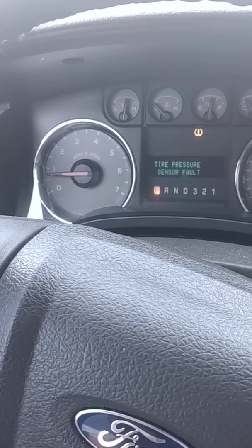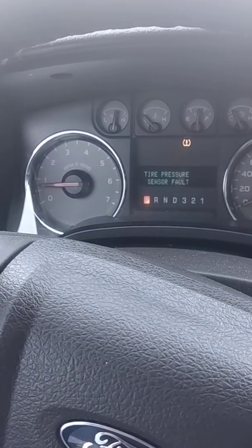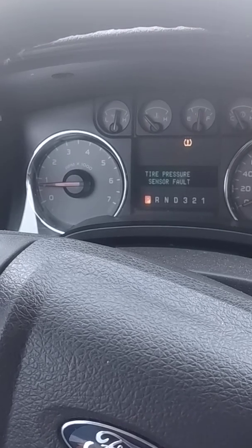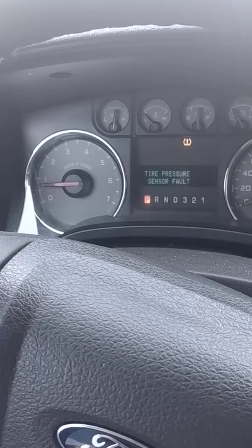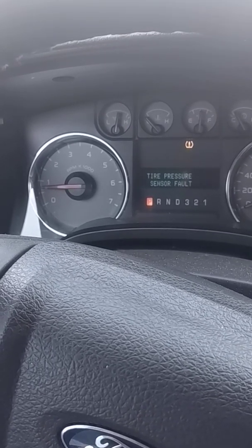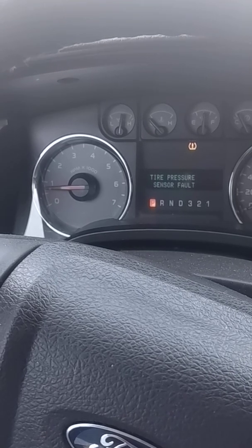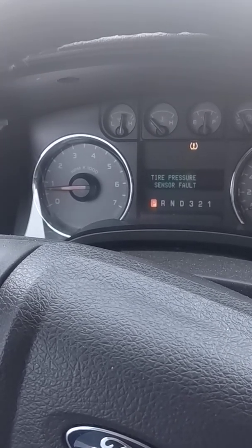So anyways, I'm going to pick, oh, and the MAF sensor. I forgot to mention that too. I did pull the MAF sensor out. I sprayed it with brake clean. I know they say you're not supposed to. So I might change the MAF sensor too. But I don't think it's the MAF sensor again, and I'll tell you why, because it seems to work fine all day. No.